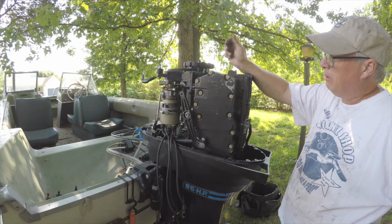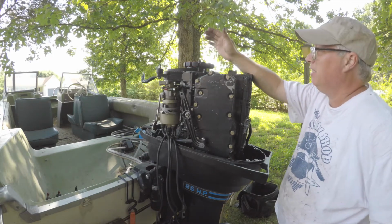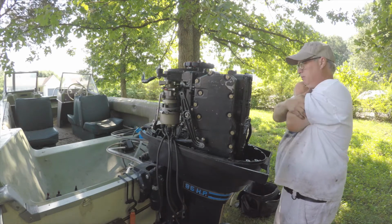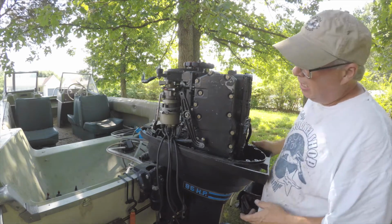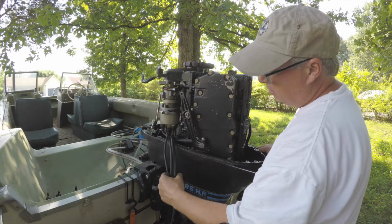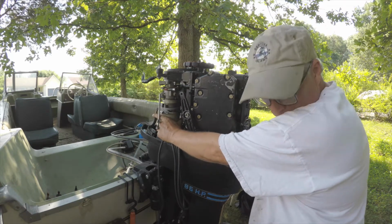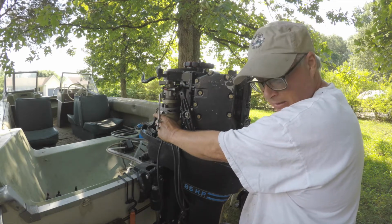So the other thing about this motor, I don't even know where to go with this. I don't even know really where to start because I was tore into it. I really didn't film it. I just went ahead, but when I first checked this, I didn't have any voltages on the switch box going to the distributor. So I suspected that the distributor was bad. And I still haven't really completely confirmed that.